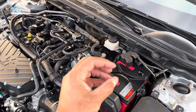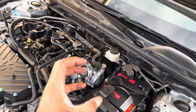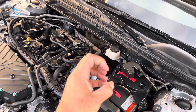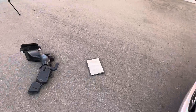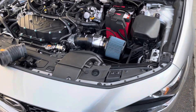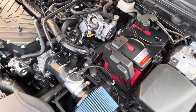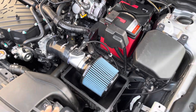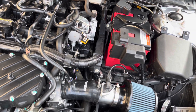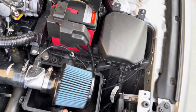As heat increases, it causes more pressure. But if you can get the same 18 pounds of pressure in a denser, cooler charge, you can have more power. I just want to let you know a little bit about why there's a resonator on the stock intake and why I think the stock box is best for naturally aspirated. This setup is also very close — I still would recommend this open setup for naturally aspirated, because as pulses come out they have a place to go and escape, and I'm still getting good airflow with the snorkel.